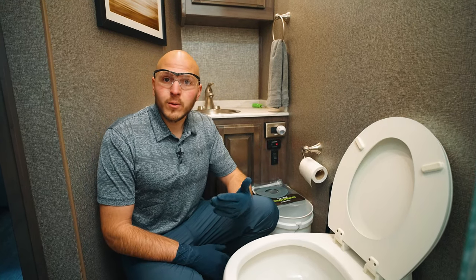To remove the pump, there are usually four bolts bolting it down. Loosen those four bolts, wiggle the pump out, and unplug the Deutsch connector. Bend the relay out and slide it down. Again — preventative maintenance. I can't stress enough how important it is to do preventative maintenance while everything is working properly. Flush the toilet three, four, five, six times — even do a couple of dry flushes. That helps get the tank empty. This is your low profile vacuum generator pump as used on the Fleetwood — it only had the newer style motor.